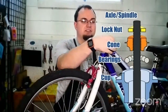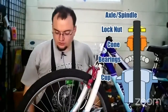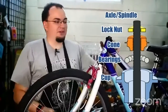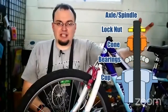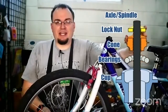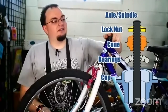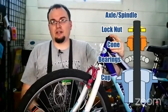This one's grippy on the side so you can tighten it with your hands. Sometimes they require a special tool like this wrench, or sometimes a really funny bumpy tool if it's a really old bike. Sometimes they don't even have cones like this. There are two different types: threaded like this one, and threadless. This is how you fix a threaded one, which is generally more common on older bikes.